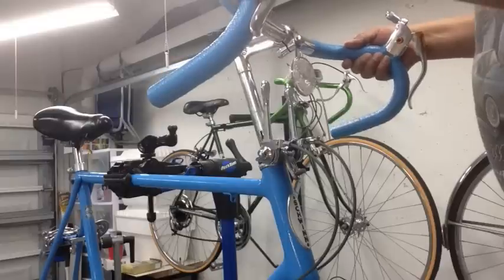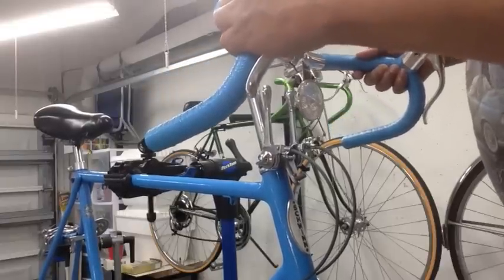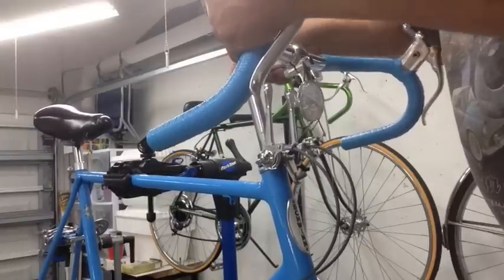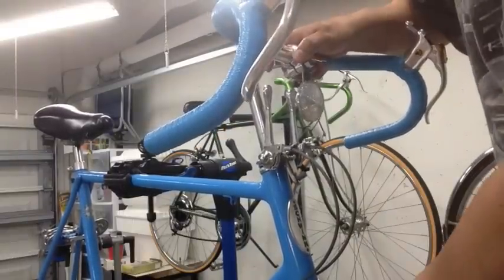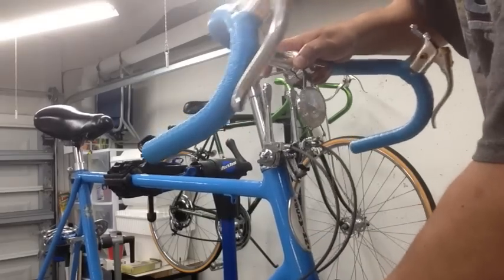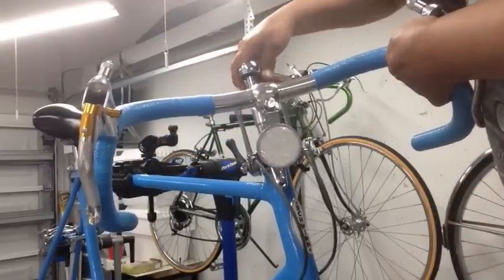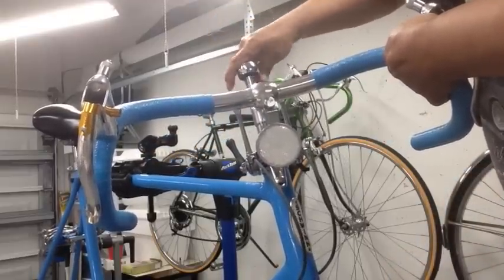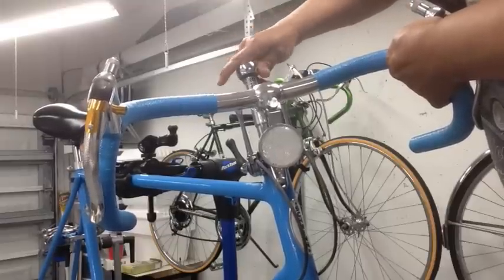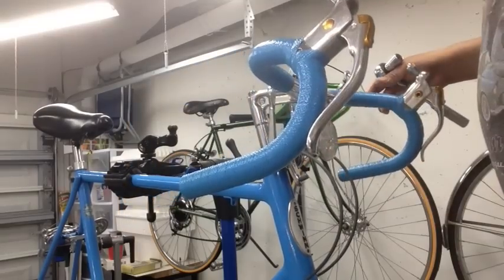And then you just slide it in. It should go in pretty easy, especially with a lube in it. A little bit of grease definitely helps put it in there. And you should already know the height. This does have a mark right there that's kind of the standard height. I just make it tight enough so it stays on there. Then when I actually put the bike down, we'll adjust it accordingly, just to get it started there.